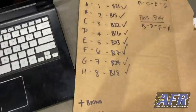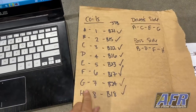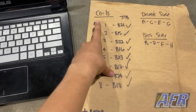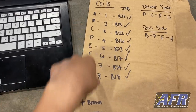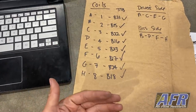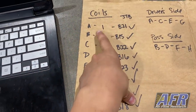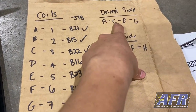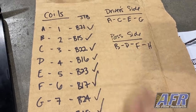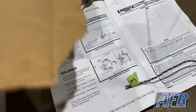While I was setting this up — Nick was helping me with this the other day but he left so I had to go back and remap and figure it out. Coils I just listed A through H. So A is 1, B is 2, C is 3 — these are your cylinder numbers, these are the wiring letters. I did what would logically make sense: A1, B2, so on and so forth. Then I came in here using this pinout and listed what pin goes with each of those, directly copying that over. And then I came over here to the driver and listed what's driver's side and what's passenger's side.